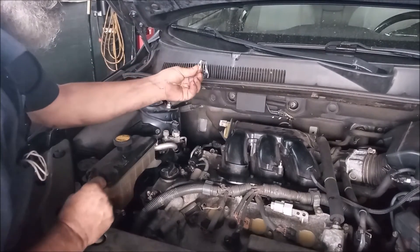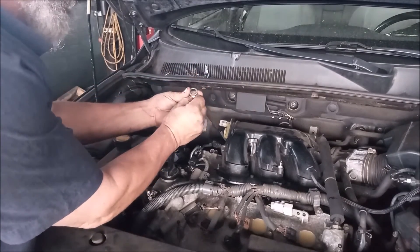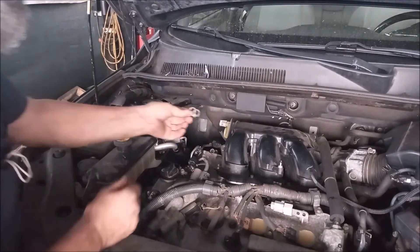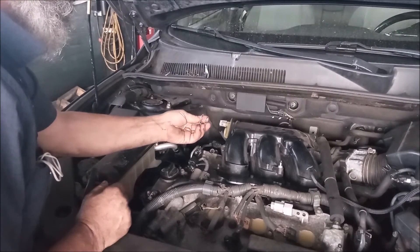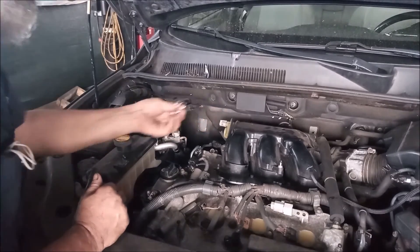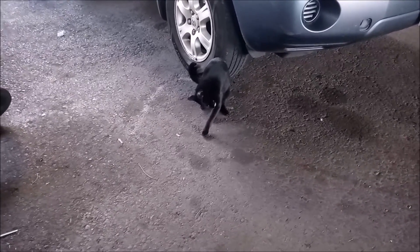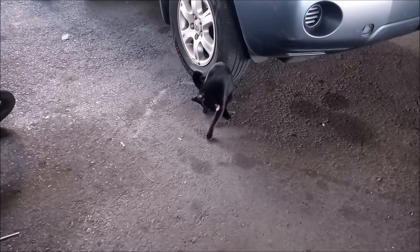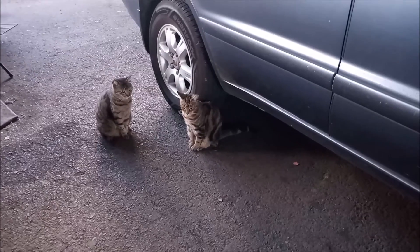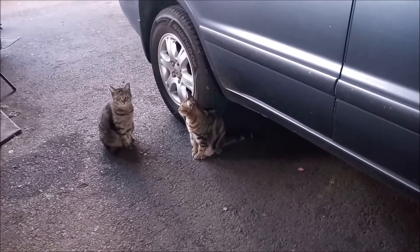This is the bottom gasket — it's a one-piece design that makes it easier to put on. We raise the line back up, put this gasket onto the banjo, then thread the banjo bolt through. My shop supervisor Blackie has reminded me that I need to torque the banjo bolts to 48 foot-pounds. And these are Tiger and Popsy who lend a hand whenever needed.